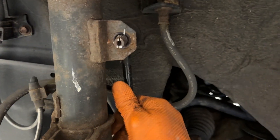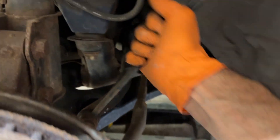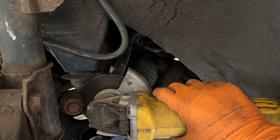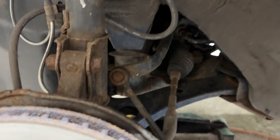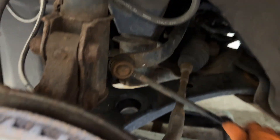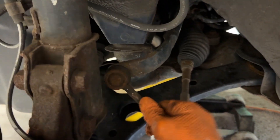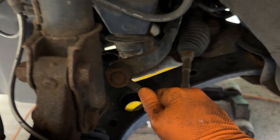Now since you should do both sides, here's a trick: once you have both links off, the sway bar can now swing freely. Look — it's now up where you can much more easily and carefully run your cutoff wheel blade against it. You don't want to hurt the face of the spring. You can even slice the top to get the socket off the ball. The other one just popped off because it was the really worn one. With the bar swung up and out of the way of the tie rod, control arm, and bottom of the strut, you can just slice it right off.